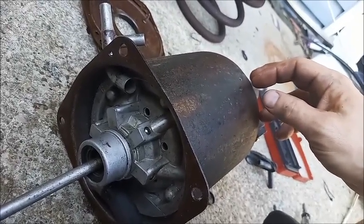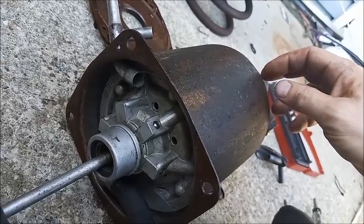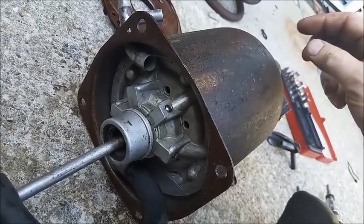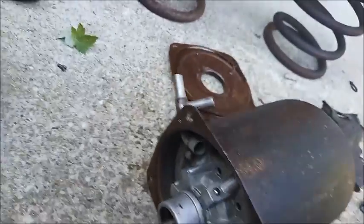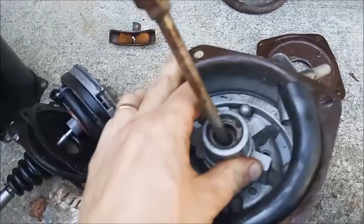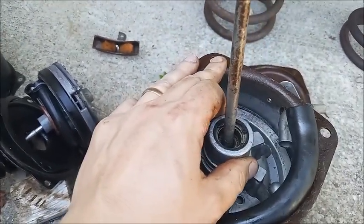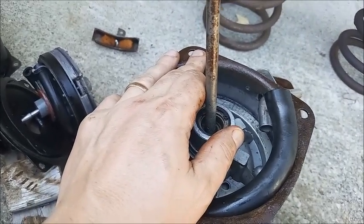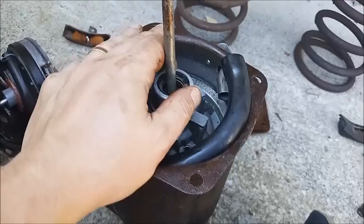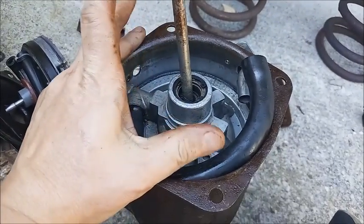And it's a much bigger spring. It tends to come out more forcefully than the Bendix, at least in my experience, since the Bendix is held in by that end plate, whereas this one can just pop freely out. It's a little sticky. So I pushed it back in. If I push it farther in, it'll come back out, but it may not come all the way out, so I may have to do some further fighting with it.